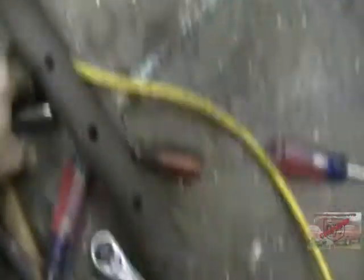I wanted to tell you guys a little something about old exhaust clamps. You see how that one's busted off? Use a cheater pipe. Sometimes it's just better to tighten and overtighten it instead of trying to loosen it, because you'll just snap the exhaust clamps. 90% of the time on a vehicle this old you ain't gonna save them anyway, and a new clamp is only like three bucks. Just overtighten it, snap the ends, and you're done with it.